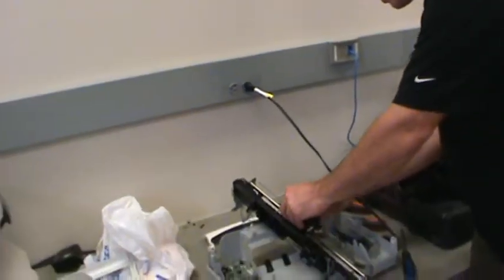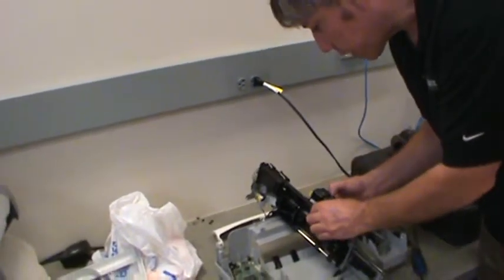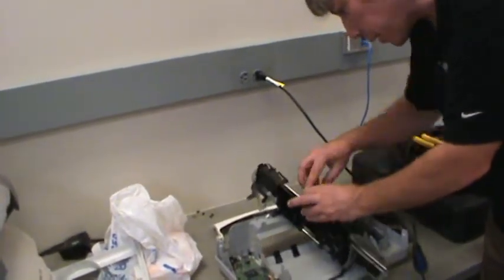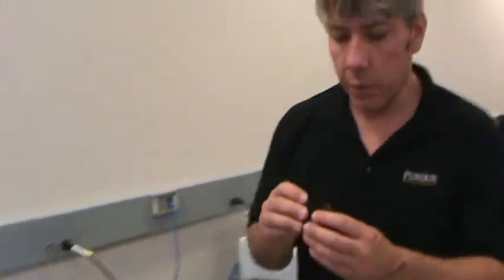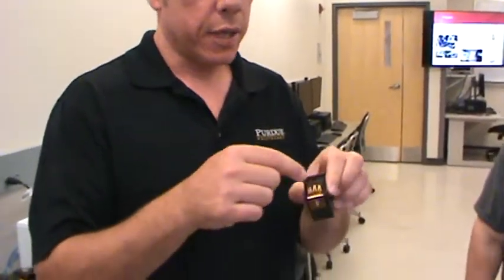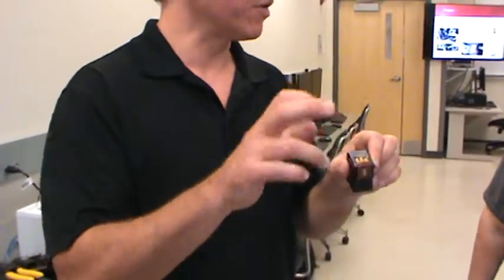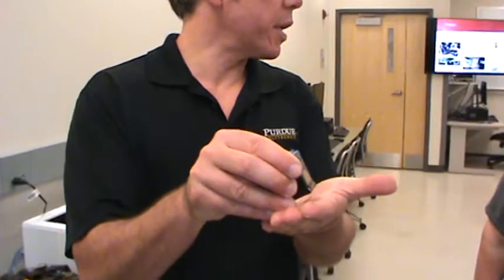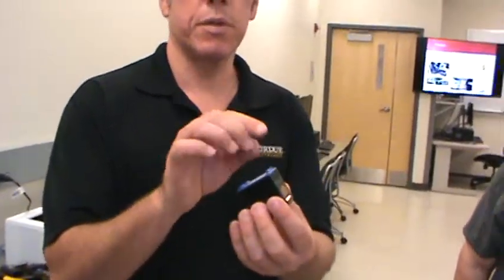You can say, well, really what's going on is the cartridge. Let's see if I can get one out of here. There we go. You can say, well, if you look at the cartridge head, really there's a lot of little holes there, and you drive the ink out of whichever hole you want to make a dot. Well, that's true, but then you have to move the cartridge, right? And you've got to be able to move it within the same resolution that it's printing, otherwise your image is going to be all messed up. So this carriage drive is actually very precise.